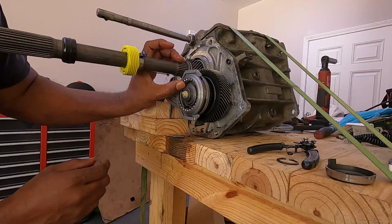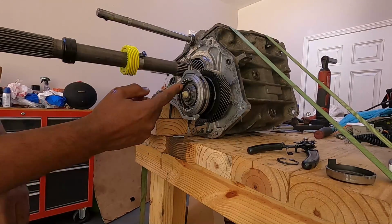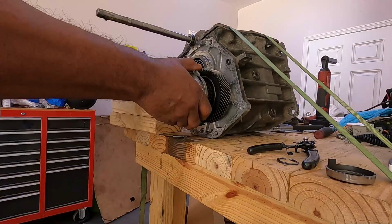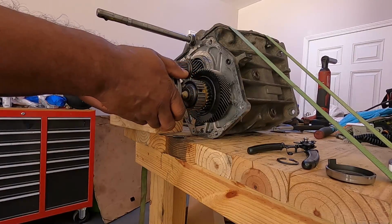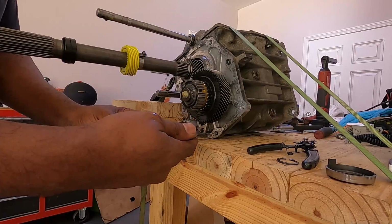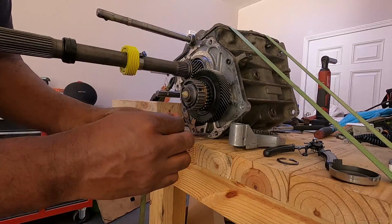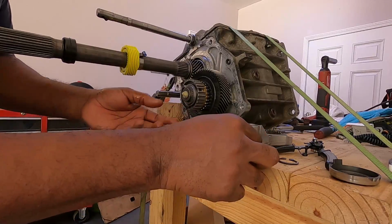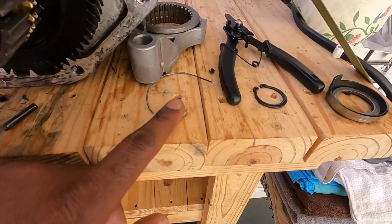See the problem already. You put the transmission back together. I'm missing the doggone synchro keys. Missing 2 of them. There's the hub and the fork. Yeah, that's some of my problem right there. I'm missing 2 of the doggone synchro keys. So as you can see, the problems that I'm starting to run into already. I'm missing the synchro keys. This is the only one that I had.